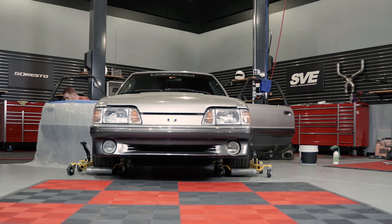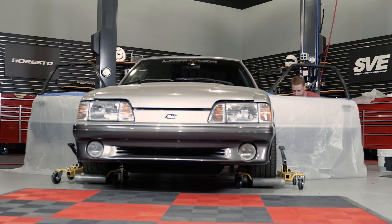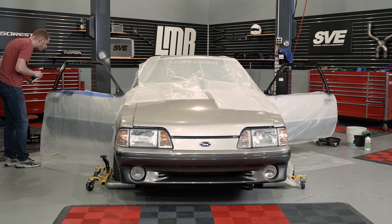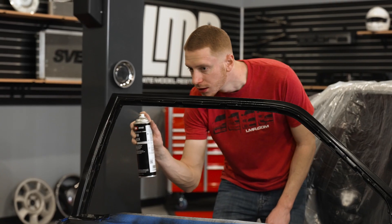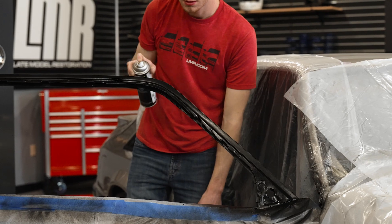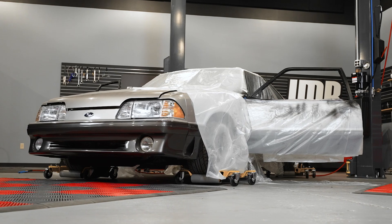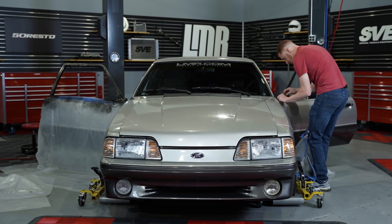You'll need an assortment of painter's tape and some thin plastic drop cloth to cover the body of the car — I would recommend some fine line and one inch wide masking tape. Start by masking the intricate areas first on the door frames, then use the wider tape in conjunction with the drop cloth. Be sure to cover all areas you don't want paint or overspray on. With everything masked off, wipe the door frame with a paint prep and a lint-free towel. Be sure the area is well lit and well ventilated, and begin painting the door frames with trim black paint. Hold the can about 6-8 inches from the surface and make even passes. Each coat should be medium wet with a flash time of about 5-10 minutes between coats. Always read the instructions to ensure a quality finish. Two to three coats are all you should need, and allow the paint to fully cure — full hardness is obtained in about 48 hours. After the recommended waiting period, you can remove the drop cloth and masking tape.